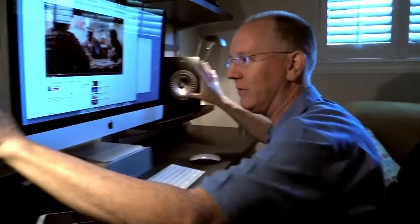They've divvied up the work, and what they've also divvied up is the amplification. The little tweeter gets its own dedicated 20-watt amplifier in each speaker, and this mid-bass unit gets a 50-watt amplifier. You need to have more power to the bass than you do to the treble, because it just requires more power to sound relatively equal. So these things have a lot of power.